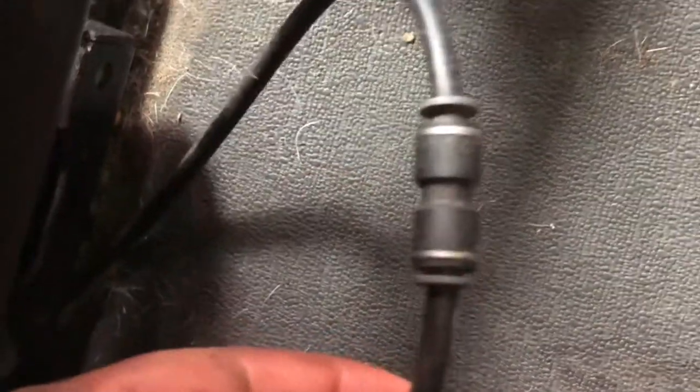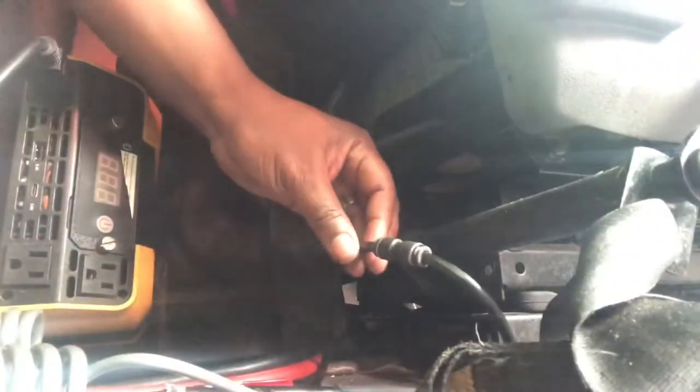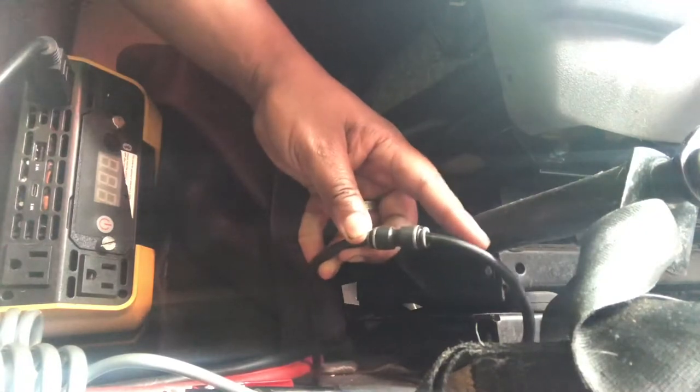There is no need to cut an airline. It should be a quick disconnect on the back of your seat, either the driver or passenger seat — really don't matter. Just push this in and pull the line out. Real simple to do, push these little tabs in, airline pops out.